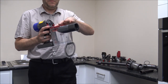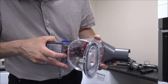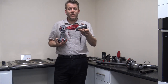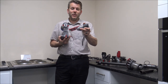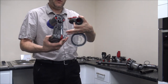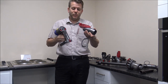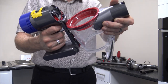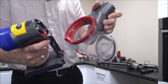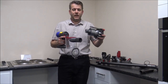The other option is you can take the bin off completely. To do that you've got a little switch at the bottom — just press that and the bin comes off. You can give it a quick rinse, though I normally recommend using a damp cloth to clean the bin just to give it a refresh. For the vacuum body itself, just give it a quick wipe or use a paintbrush. When putting it back together, locate the contacts here and make sure you don't get these wet, as it can damage the vacuum and wouldn't be covered under warranty.